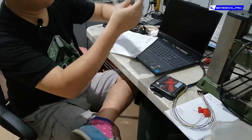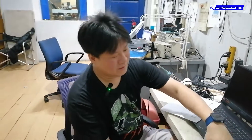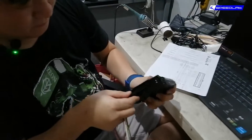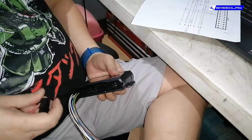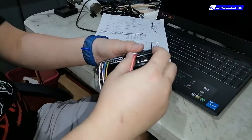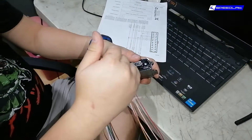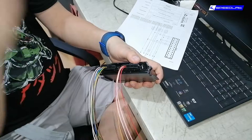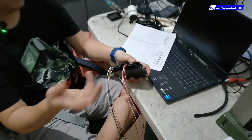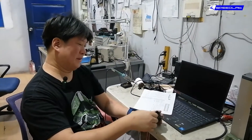There's another set of wires that go to the pedal itself — to the throttle. One goes to this socket, and the other goes on the other side. This is the additional output control. This can control throttle, and there are other slots to control boost, nitrous, and additional injectors. It's quite flexible when you want to build a specialized engine setup.